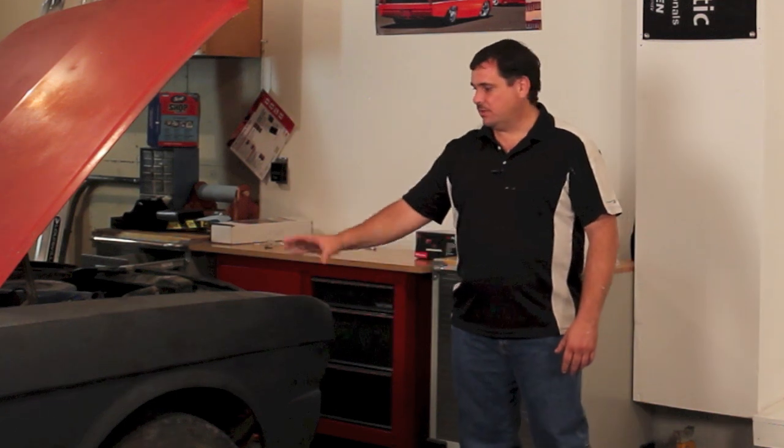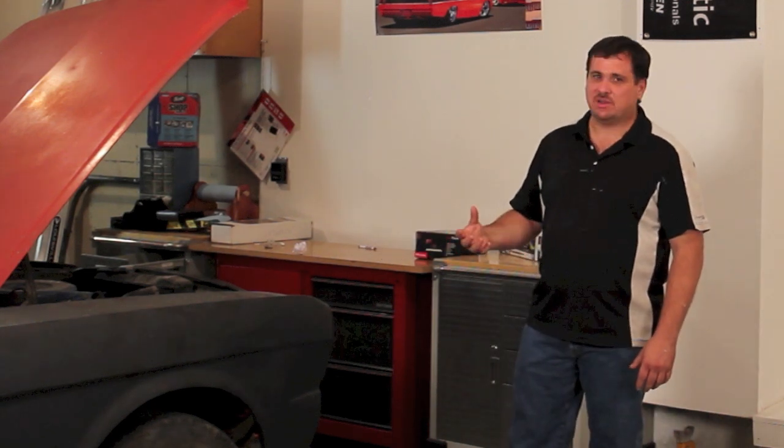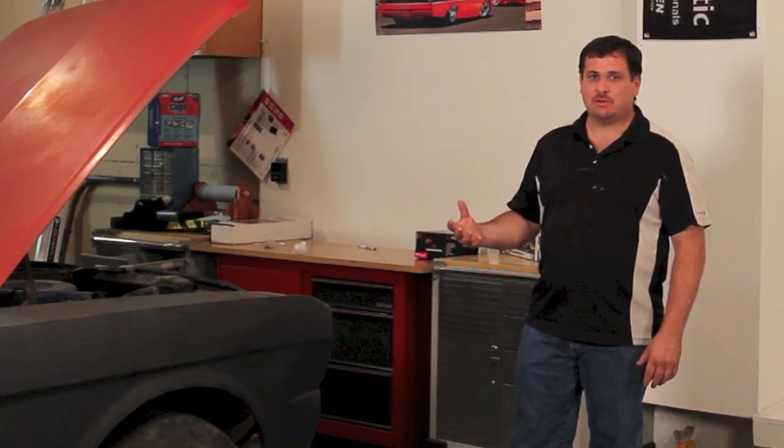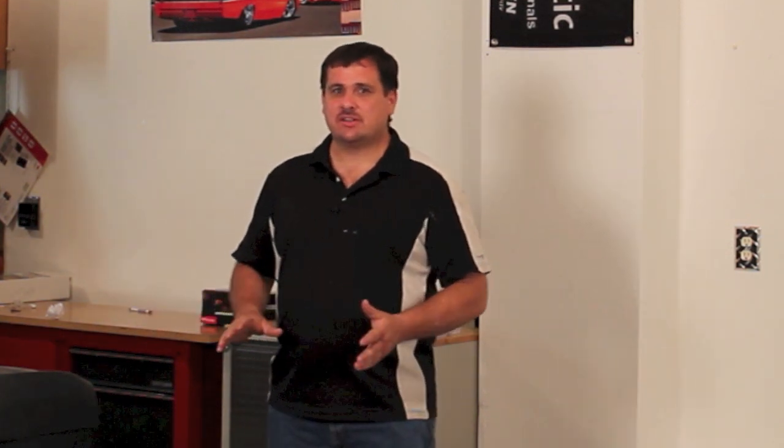With self-etch, if you put it over different layers of paint and apply it too wet, it's going to lift because self-etching primer has acid in it — so you need to be aware of that. Some advantages of self-etching primer over epoxy: it's a little bit simpler, there's no induction time, and there's even a 1K product that comes in a spray can. If you have just a small area and want corrosion protection, that self-etching primer in a spray can may be the way to go. Very simple.